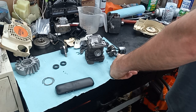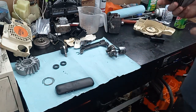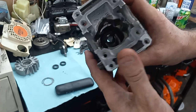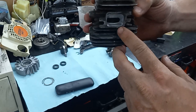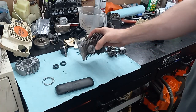I think the little top-handle 192 might share the same rings as this — I might look into that. But I can show you the port work. Nothing special: modified the intake lowers, didn't touch the uppers, didn't raise the exhaust but changed the shape of it, and cleaned up the combustion chamber a little bit. We're gonna roll with it.